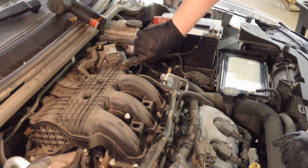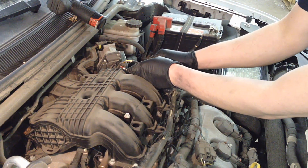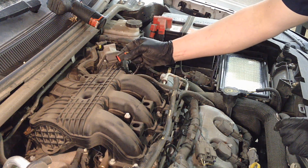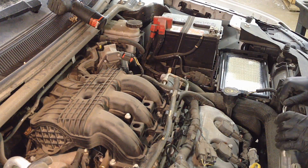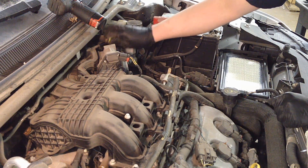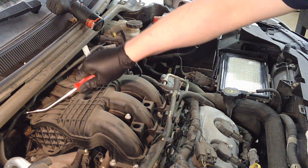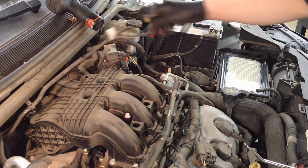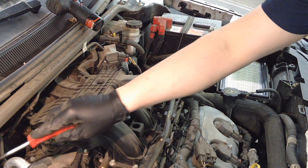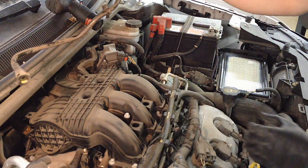Move that off to the side. Release the red retaining tab right here on the throttle body — you'll see it when I pull it back. Press the tab right here and pull it out. There's another line right here with a quick release — that little yellow tang. Get it off to the side. The cat claw tool comes in very handy here. Follow the line over and release it — same thing, it's got a yellow tang on it.